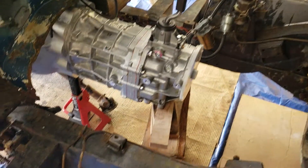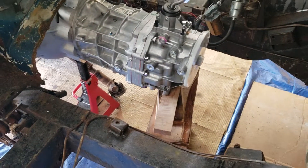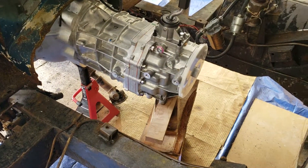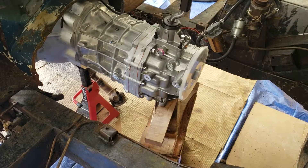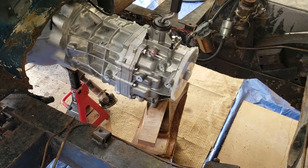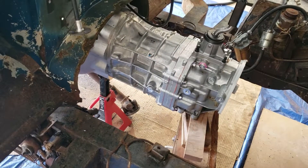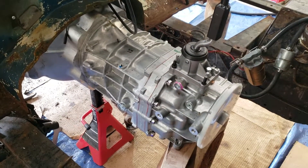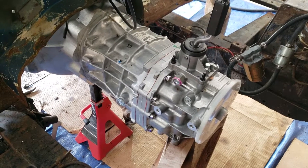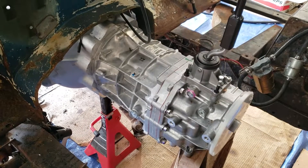The rest of the day is gonna be spent fabbing up a rear transmission mount, and then I'll do a lightweight transfer case — I don't know how I'll do it yet, but something lighter than that original tank-size thing. Doesn't have to be — they did what they could with the metal at the time, but right now you can get eighth-inch that'll outdo anything this stuff does: be stronger, lighter, and easier to fab up.